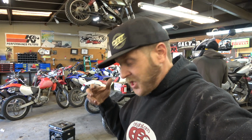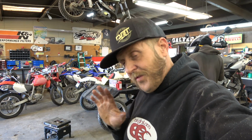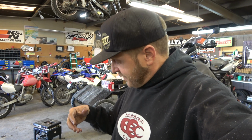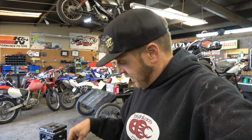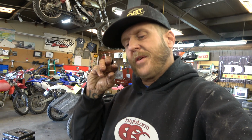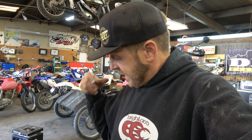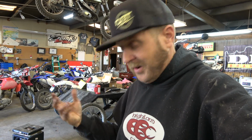I'll go ride it. I don't think that's going to change anything on the way it runs, to have the air filter just a fuzz closer. Also, this air filter, the funnel web guys are already a little bit less volume than the stock ones, so that helps too. So if you want to get a different air filter, that might not be a bad idea to go with that style. It's also got a plastic part that goes over the nub on the cage, which makes me feel better about it going over that rough little spot. So I'm gonna take that cage back out and clean it up really good, make sure I get all the little bits off of it, go ahead and clean the air filter and reinstall it. So yeah, I'm psyched about that.